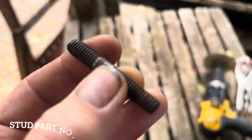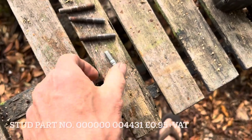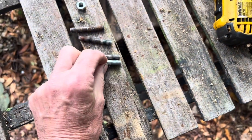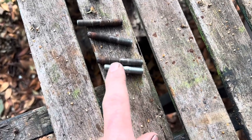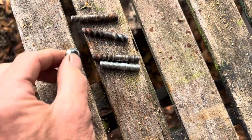Now when we were taking those exhaust manifolds off, four of the studs came out. We're just going to clean them up with a wire wheel. One of the fittings was actually a bolt and not a stud, so we've ordered a new one from Mercedes. You can see that whilst it's the same length, the bit that actually goes into the engine block — the bit that sticks out — is shorter, because on these ones the nuts go all the way to the end.